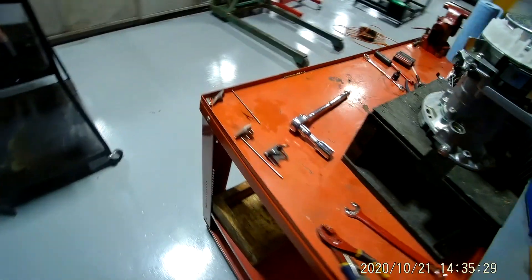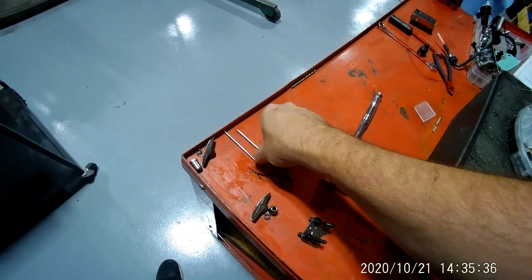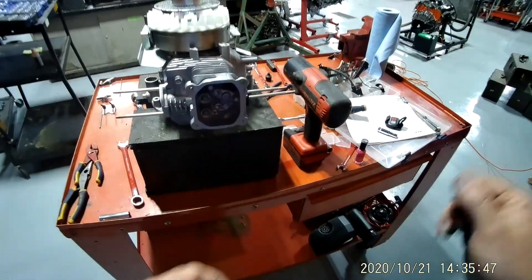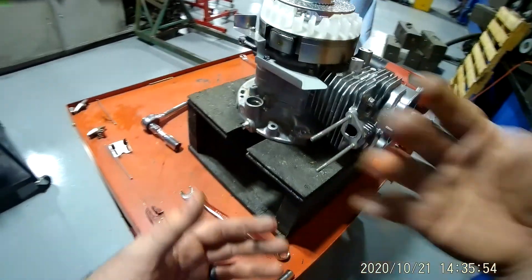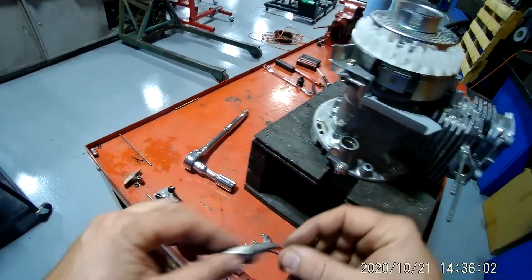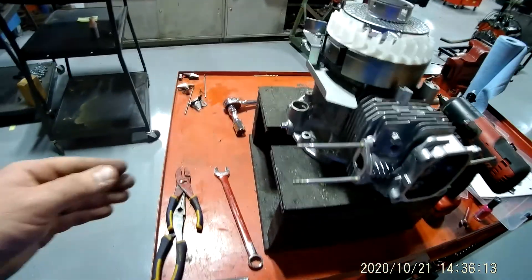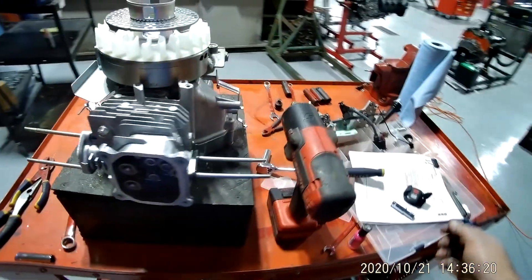Show me that you got your rockers out. Make sure you do not mix these up. In some engines push rods are different lengths, so you definitely don't want to mess your push rods up. The general rule of mechanics is: if it came out of here like this, it should go back in like this as well. Your engine will always run better if you put the same piston back in the same cylinder, and if you're reusing your rocker, put it back with the same one it came out of. That is how you make sure your engine is going to run the best.